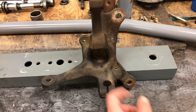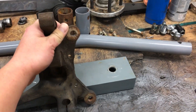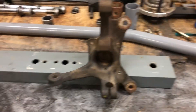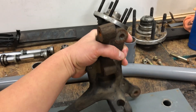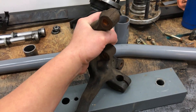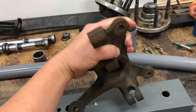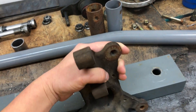The Part Shop Max ones are really exaggerated. Basically what caster trail means is you don't have to put as much caster into the car, and when you don't put as much caster in, you don't have to run as much negative camber to get the contact patch of the tire flat when the car is at lock or big angle. As you're drifting a right-hand turn and counter-steering, the leading wheel's contact patch is going to want to tilt as you turn — inherent physics — and when you add more camber it pivots to compensate. With caster trail you don't have to add as much camber.